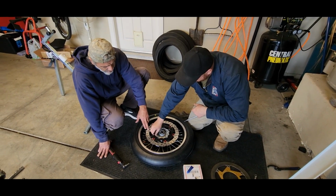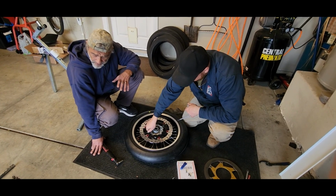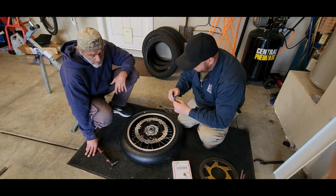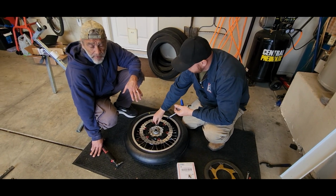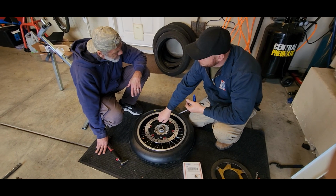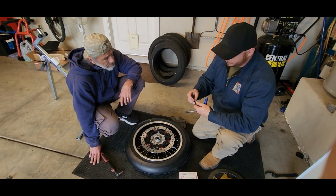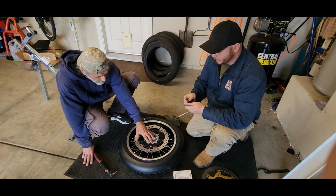Later on, we're cleaning the rotor before we actually put the new brake pads on. We're using brake cleaner for that, an easy job. And then we follow the braking-in procedure that BrakeTech recommends. They actually added an installation manual to it. The braking-in procedure has some importance there. They included it in the box, so if there's any doubt at all, you can always trust what BrakeTech tells you. It's their product after all.